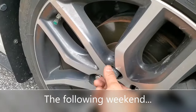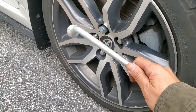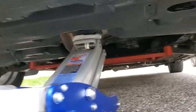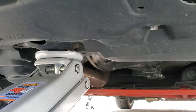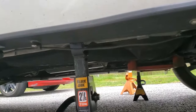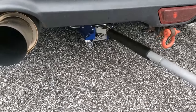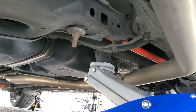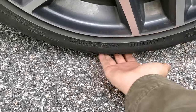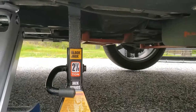The first thing we want to do is loosen the lug nuts on all the wheels — don't remove them yet, just loosen them. Start with the locking lug nut first, then use the lug nut wrench from the back of the car. With the parking brake engaged, lift the front end of the car up. A three-ton jack works better, but a one-and-a-half-ton jack will still do the job. Once it's high enough, stick your jack stands underneath between the two notches and gently lower the car onto them. Raise the back end up from the rear point and lower it onto two more jack stands between those notches. If the front wheels aren't clearing the ground, put the jack just behind the jack stand and lift carefully, then raise the jack stand.